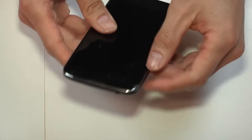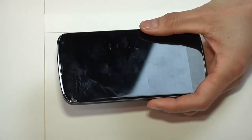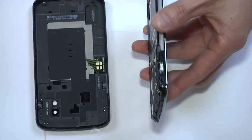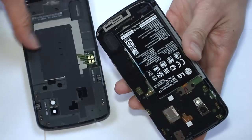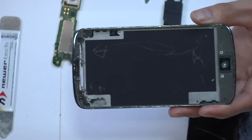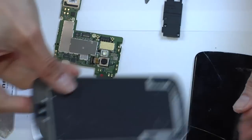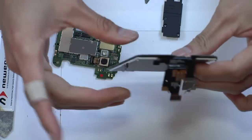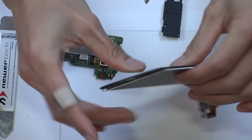My old phone was broken in the upper left corner. We'll eventually pry it off from the chassis so we can replace it. You'll generally start from the back of the phone and work your way through several layers. I used a hair dryer on the sides and later near the battery to soften any glue that helped keep everything in place. By now I have fully disassembled my phone. This is the part to which the screen is attached. It took quite a bit of time to separate the two pieces. As for the old screen, you'll notice that I had to crack it even more during the process of separation. Be extra careful in this step as you may cut yourself with these small pieces of glass, like I did.